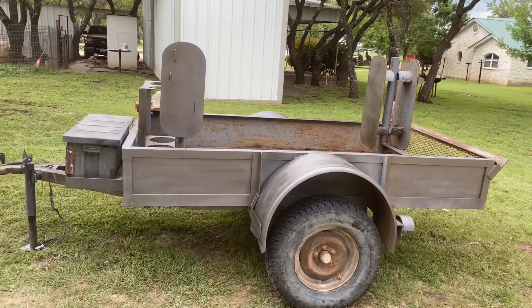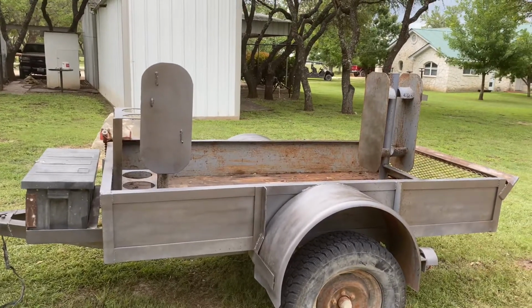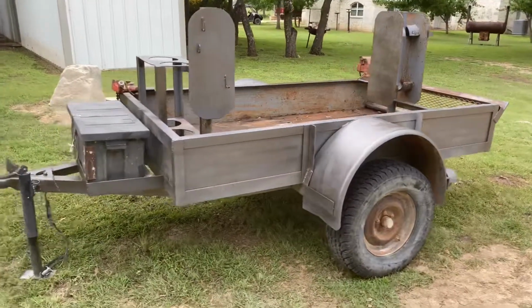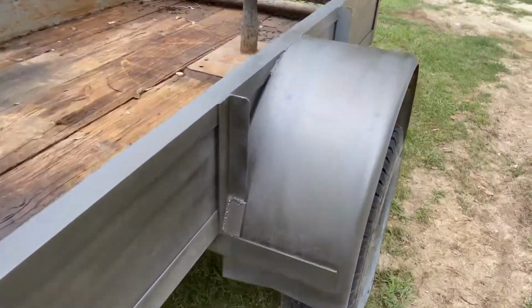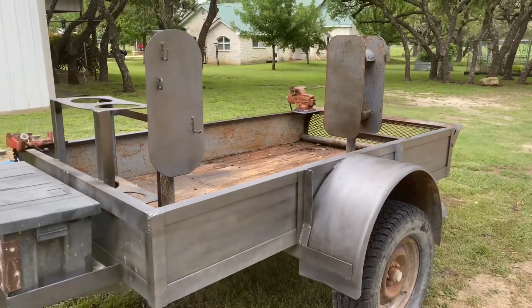I just got done spraying the first coat of paint, but this stuff went on really, really thin. So I'm probably gonna spray another mist coat, not super misty, a little bit more thick this time, where it gets more coverage. But as you can see, you can see all the metallic in it. It's really, really shiny now. Let's get to painting this thing for the second time.